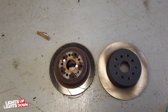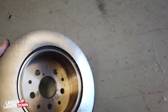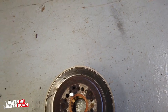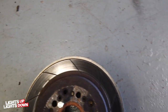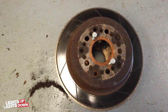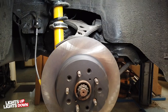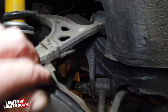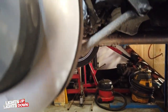Disc's off - there's a bit of a size comparison. Not as much of a difference as I was expecting, to be honest - we're talking about 10mm all the way around. This is the rear, and obviously the calipers are going to make the most difference. So let's get it fitted. That's the new disc fitted. I pushed back the dust guard on the back - just pushed that back out of the way rather than cut it. It seems to be working all right. If there are any problems later I will have to cut it, but I think that'll be fine.